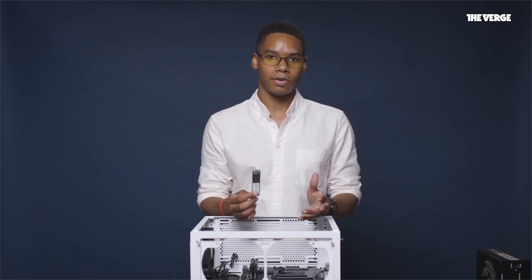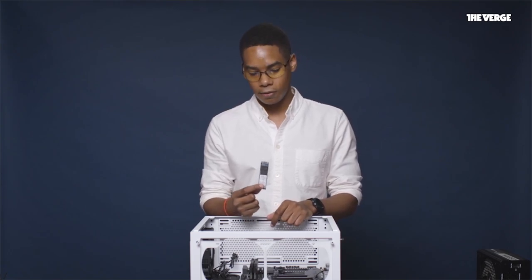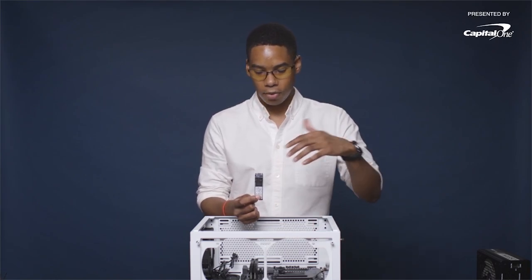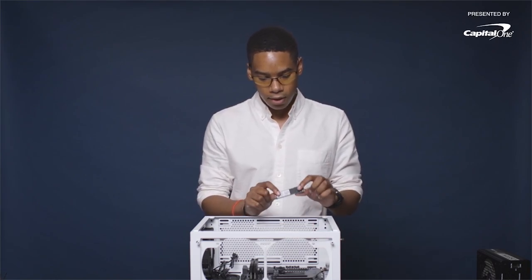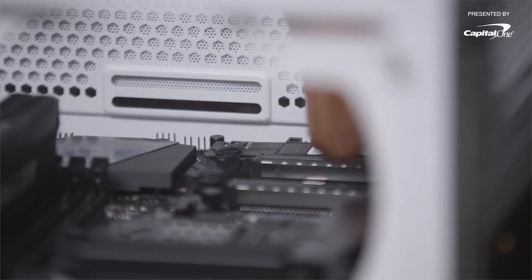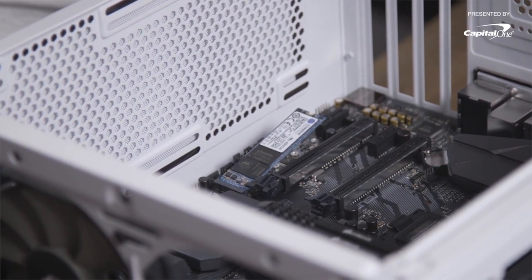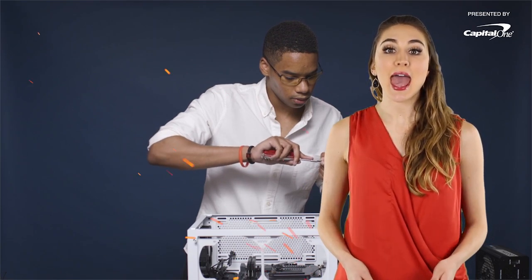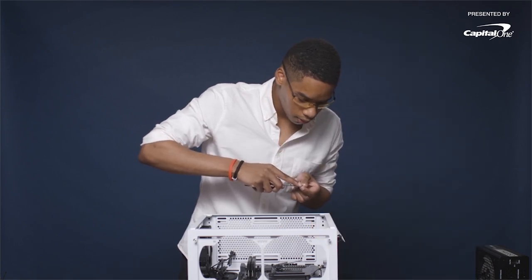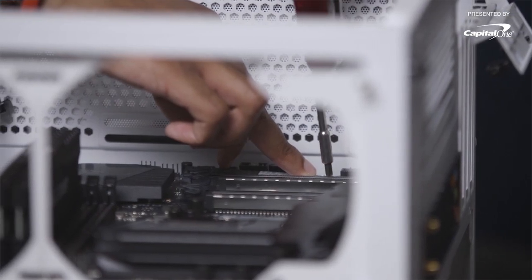Step three, we're going to install the hard drive — in this case, the NVMe SSD. I chose this format of solid state drive so that I could input it into the motherboard without having to worry about extra wires or putting it in a separate part of the case. This is from Kingston and it's 480 gigabytes, so it's not a lot, but you can always upgrade and swap it out. It's only held down by one screw and the latch, so it's really simple and straightforward. When installing a M.2 drive, make sure the standoff is installed first. Speed for gaming is important — you want files to write quickly and games to load quickly, so that's why it's best to use an SSD.